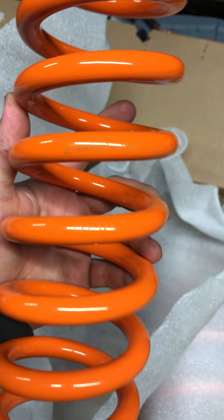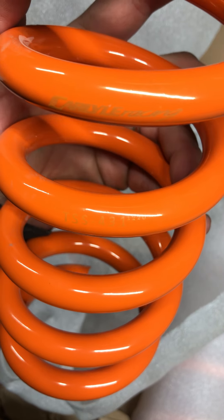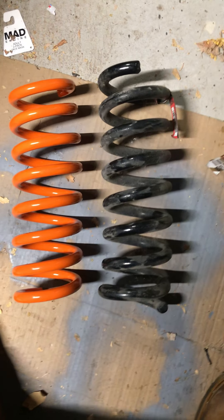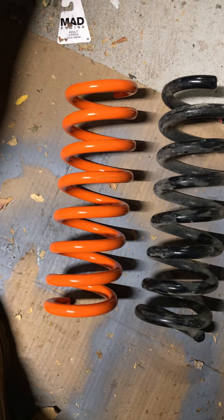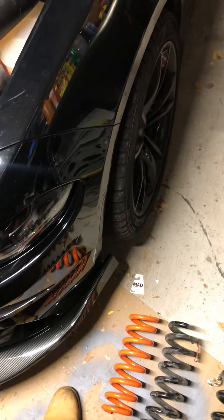Carlisle — I do like these a lot. These are very, very well made. That looks like a part number. These look very similar front and back, so I think that should not be any issue whatsoever. The D2s are in the vehicle currently — it's a 1.8-inch drop in the front and 2.0-inch in the rear as far as height dimensions and how far it lowers.